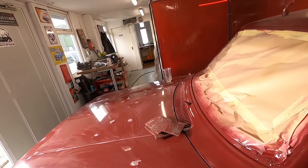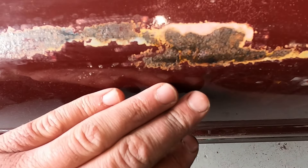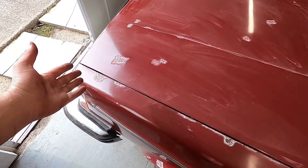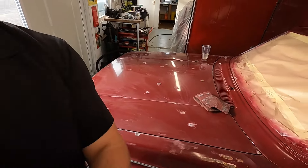I've got rid of all the crusty bits — this is natural damage and it's now gone the correct rusty colour because I've put salt water on it and left it for a few days. I'm feathering the edges of these blisters and I'll put a little bit of salt in them. Why? Because when I clear coat it, I don't want it to look like I've done this artificially. All these individual rust spots were on the car, but you can't clear coat with crusty bits hanging off — the paint won't stick. It's all a big experiment and I'm really enjoying having a bit of free rein.